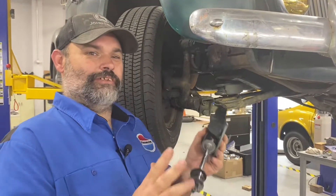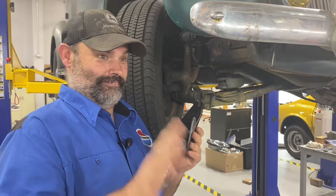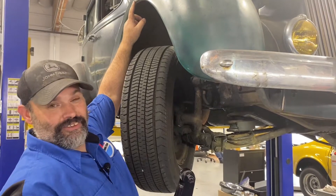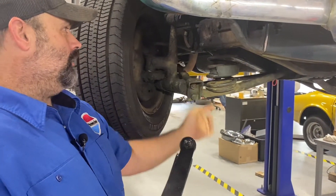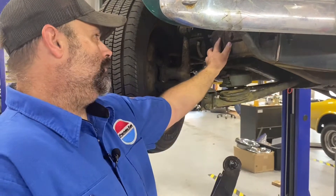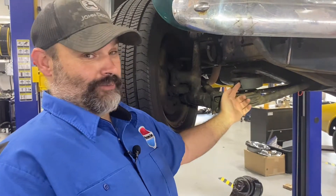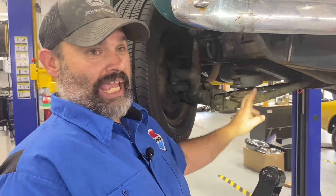Okay, just to give you guys an idea what the final version of this will look like — our original ride height sitting down loaded is 26 inches from the ground to the top of the fender arc, or if you're a Packard person, the crowned fender. But this is where we're going to drill through for our shock. Then we're going to tack weld to the frame here just for the mock-up. We have a rivet here, so we had to open up a hole in the back of the plate so we can get flush onto the frame. If you guys notice why I said the front end had been lowered too far — we put a rubber one-inch spacer in here to try to get some ride quality back and get it off the ground.